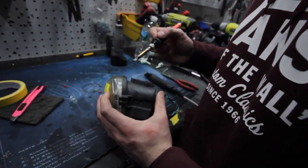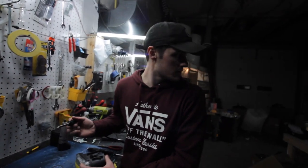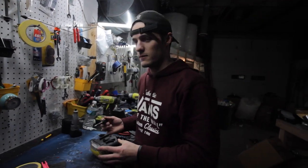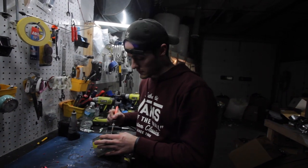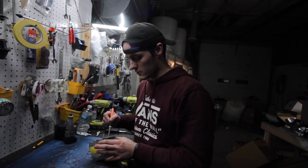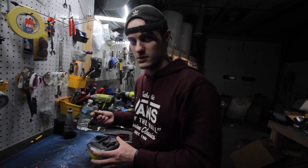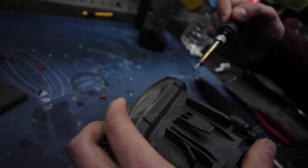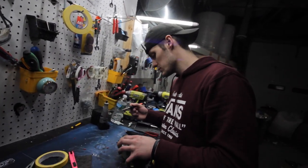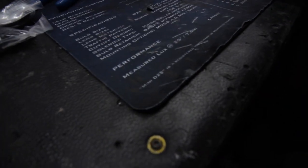It could be a lot messier — this is pretty good. You're not going to even notice this from the back. What Jeff does when he reseals tail lights, the line of silicone is very thin and it almost looks like nothing — it doesn't look bad at all. We haven't even gone over it with silicone yet and it already looks really nice, plastic welded back together. Still figuring out the speed to go across at — this is set at 662 degrees.